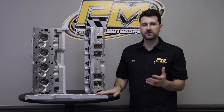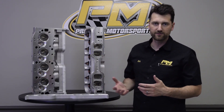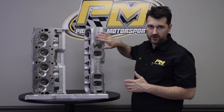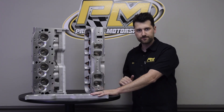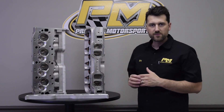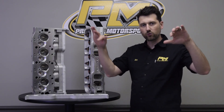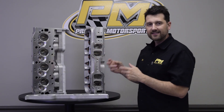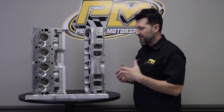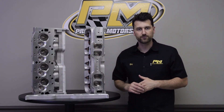As far as sealing these plates to the cylinder head as well as the intake manifold, there are a couple of options. The easy way would be to use a paper gasket between the cylinder head flange and the spacer plate, and then also between the spacer plate and the intake manifold. The thing you have to remember is the intake manifold is machined at an angle, so as you tighten the fasteners the manifold wants to move. Take that times two with a paper gasket — one on each side of the spacer plate — and we really weren't comfortable that our ports would still be aligned properly once we torqued the manifold in place.